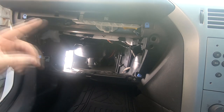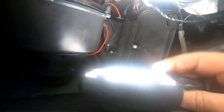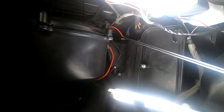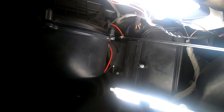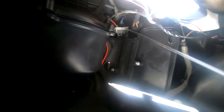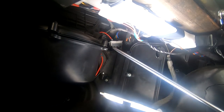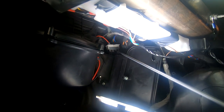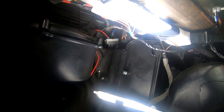So that's the four screws out of the glove box and the six screws off the actual motor itself. Up inside here you can see where that red wire goes — up inside here you'll see a little tiny red wire coming down off the motor and onto this little tiny white housing. That's your resistor. Just popping that up, there's a little tiny clip on there but you can just bypass it. There's your resistor — all you've got to do is pull that resistor up and out and remove it. There's a red wire and a black wire on there and a little tiny universal plug with a little tiny plastic clip which you need to take out.